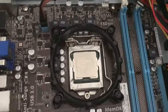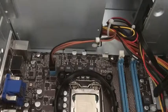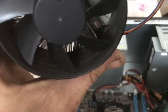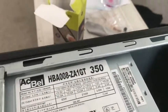As you can see by how clean my CPU is, I never had any thermal paste on there because I cleaned my CPU fan at one point. The stock cooler was dirty as heck — these things attract a huge amount of dust. You can see the markings around the side — that scoring is from the fan actually wobbling and hitting it. Pretty sure that fan is done.